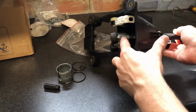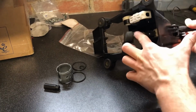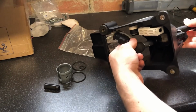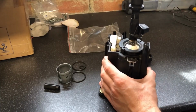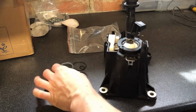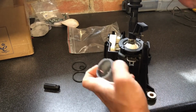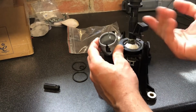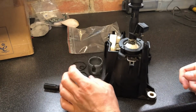This also has the R&D quick shift, but there's a new one on the market that's a bit longer and will shorten the throw even more. So I'm going to get hold of one of them as well. So you can see the amount of play side to side. Now that's in gear, and that's the sort of play. If you go out there, check your own one, you'll see that, and then order yourself a new bush, and then get ready for the next video, and I'll show you how to replace it all. It's not difficult at all.